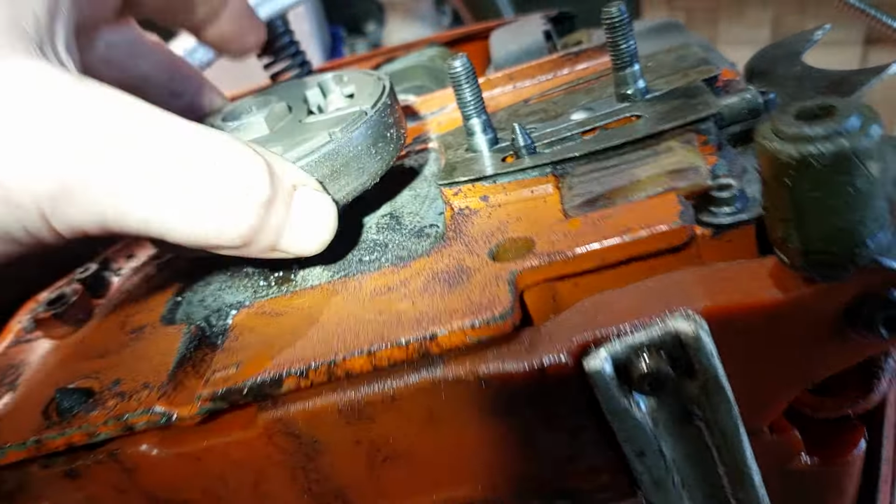Springs are all tight, roughly. This one's moving, but that's still alright. I've seen them far worse worn out than that. That's still usable. Sorry guys, I need a drink. Almost out. Okay, the drum's a bit dry, but it's not as bad as I've ever seen. I've seen just dust. The rim drive needs replacing, so I'll replace that for him, because I'm a good boy.